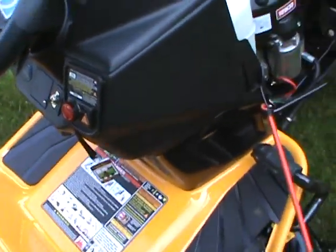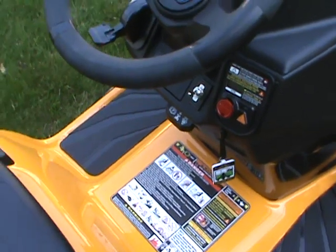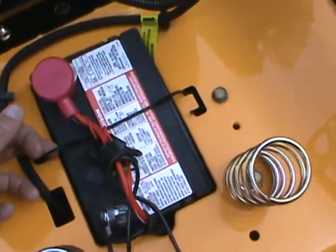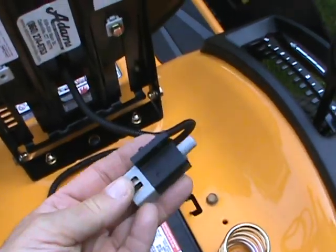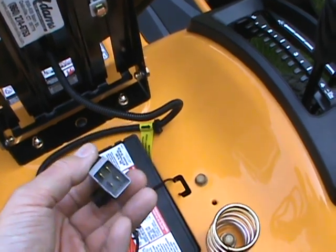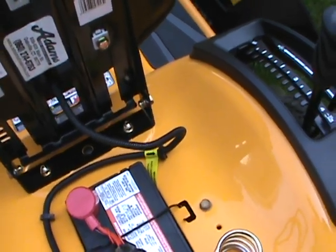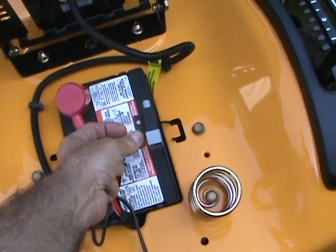One thing I really hated about this tractor was the reverse shut-off — I got caught by it three times. If I forget to hold this button for three seconds when I'm cutting the grass, the machine will stall out with no recovery; it just shuts off. So what I ended up doing was pulling the battery out — just pull this wire off, take the two nuts off, lift the battery out. You'll find a switch that looks just like this, bolted down with one nut and plugged in at the back. All I did was take it to my bench grinder and ground the post off right here. So now when you throw it in reverse it doesn't activate the switch and it doesn't shut off — saves a step. That switch is located right in the rear end over here; pull the battery out and you'll see it sitting on the transaxle.